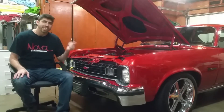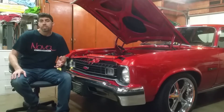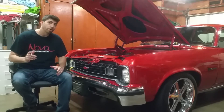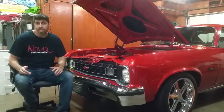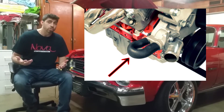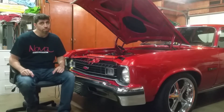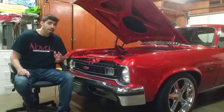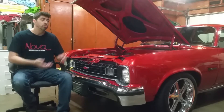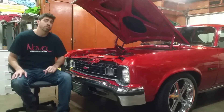There you have it - the installation portion of the heater control bypass valve in my Nova's engine bay. There were two reasons for doing this. The first one was the LS water pump - it has to have constant flow the way it's designed. You can just loop the two nipples, and a part number for that is in the description box below. But I didn't want to just loop them - I wanted heat in my car. So this valve provided the solution to the LS water pump requirement and brought heat into the cabin by allowing water to go into the heater core.